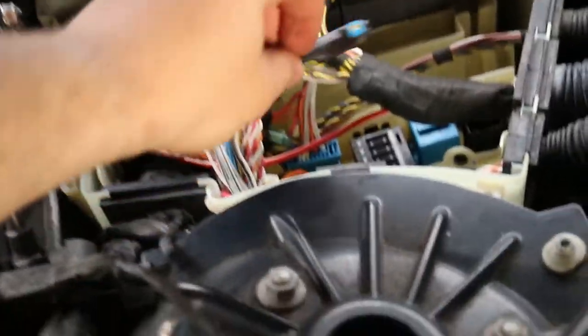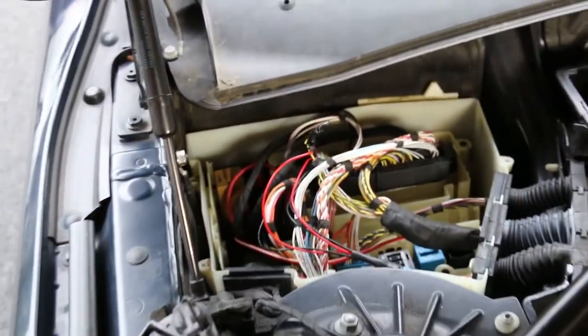You're going to want to make sure you route these wires in a way that doesn't interfere with anything, and you can properly install that lid back on without any room for water, dust, or termites to get in there. If you do have MHD flashed, you probably shouldn't be getting a code or any check engine light related to the O2 sensors if you've got catless downpipes, especially on a map that supports it. If you don't, you should be getting a check engine light unless you've got some special ECU or JB4 — I'm not sure if JB4 suppresses that check engine light. One way to test those values if you have MHD is to flash back to stock and play with that potentiometer until the check engine light clears.